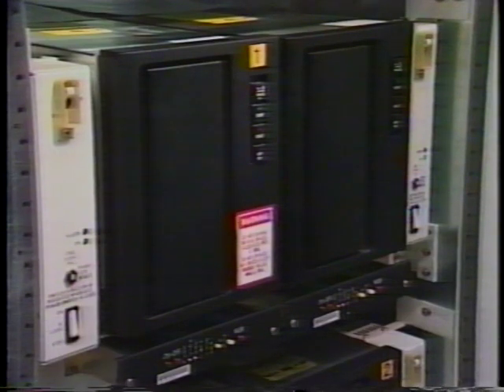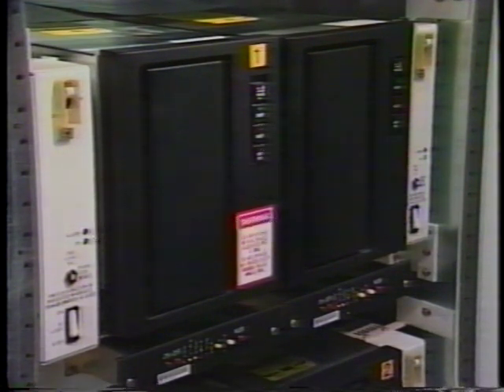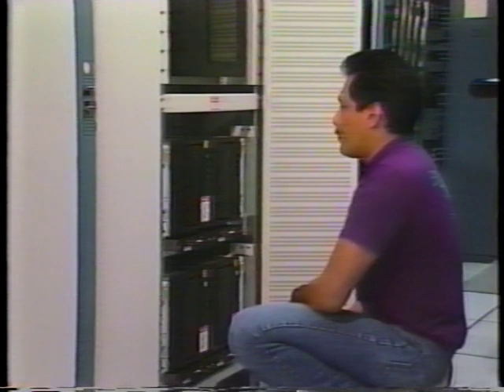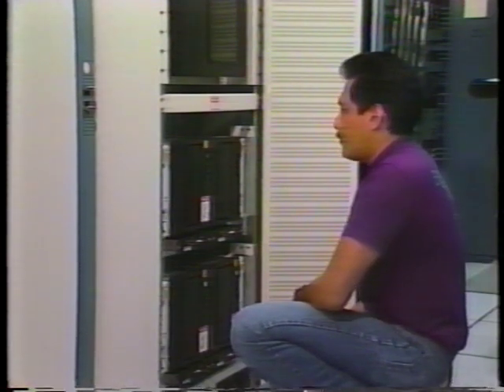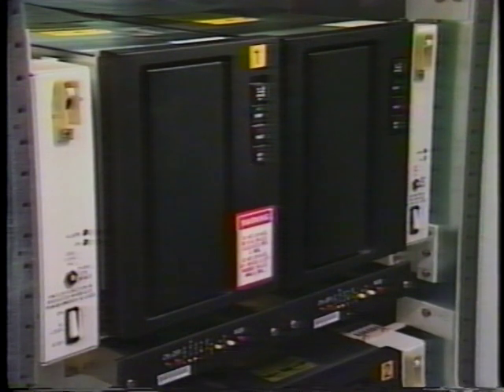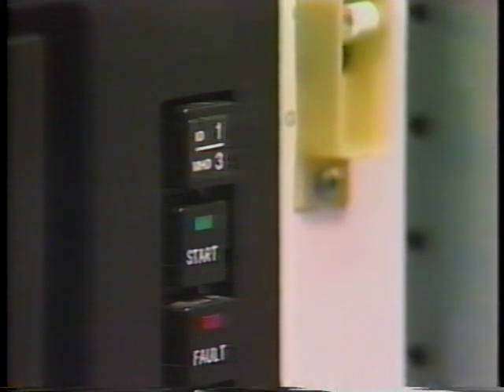At this point, make sure the new drive unit is at room temperature. If not, wait two to three hours before going on to the next step. When the drive unit has temperature stabilized, spin up all of the drives on the same DFC series. This is done by depressing the start button on each drive unit, then waiting for the start LED to flash. As soon as the LED goes to a steady lit mode, the drive is spun up.